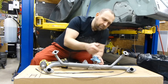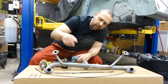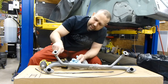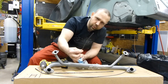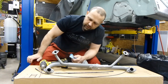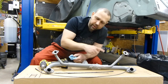Once you've broken through, try to blow air from one side to the other, back and forth a few times to empty out as much as you can, then repeat the process with the cable. I've seen some people drill holes onto the side here to avoid the first section, but this first section really isn't that bad most of the time. It's not worth drilling a hole and patching it. Start with the short one, then medium, then the long one, and make sure you're checking how much airflow you have — you should have unrestricted airflow once it's cleaned out.